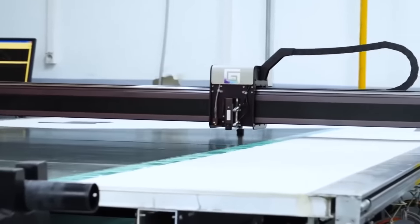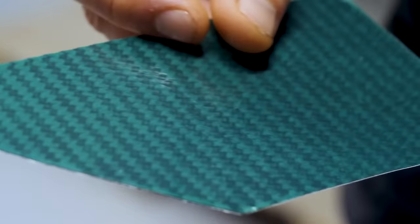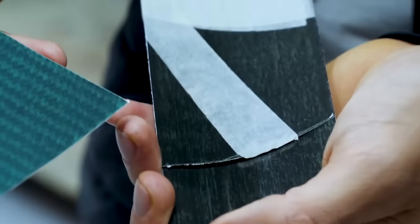So you're absolutely right. The loads that are going through our suspension members are colossal compared to what we go through on a road bike carbon frame. However, the section of the component is also a lot greater. We may well be working with ostensibly very similar materials in terms of performance, but because we're using so much more of it, the cross-sectional area is so much greater. That means that the stress acting on that component is probably equivalent.